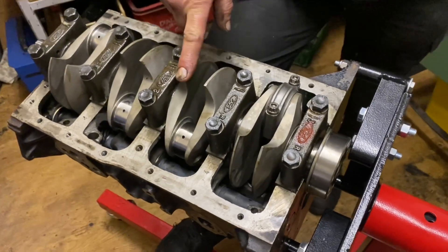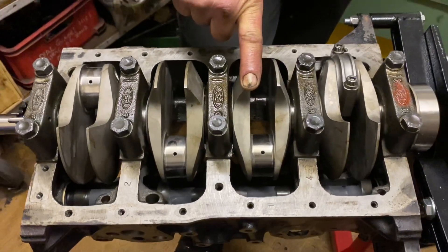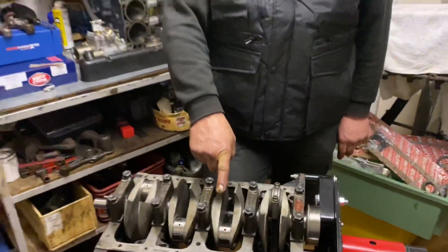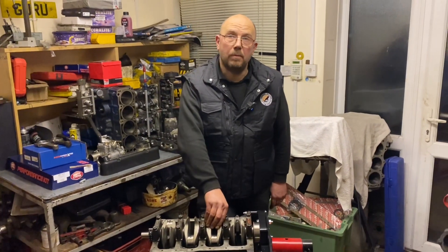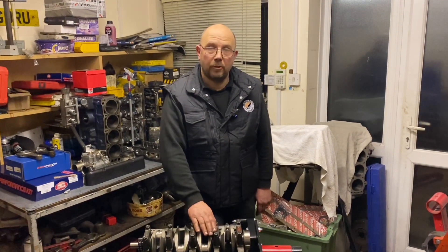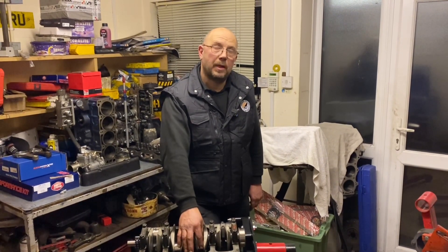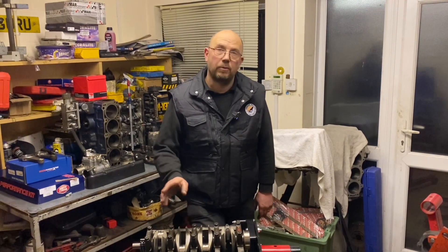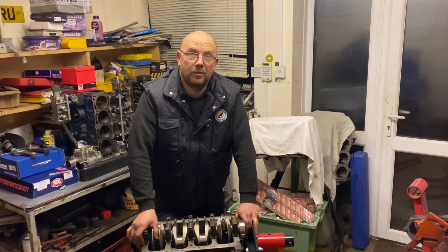The crankshaft is pretty much the heart of any engine. The 84mm stroke on this steel crankshaft is what will give us the 1906cc, as opposed to the 1750cc we'd get with just an 85mm bore. The crank itself is a Chinese unit - looks okay and I suspect more than man enough for the job. As we've already shown, it does create clearance issues. If I were doing this from scratch I'd probably use a custom crankshaft with a smaller crank pin, and therefore we wouldn't have such clearance issues between the con rod and the camshaft. But we've got what we've got - we need to make it work, and that's what we're going to do. Click subscribe to make sure you get the next instalment.